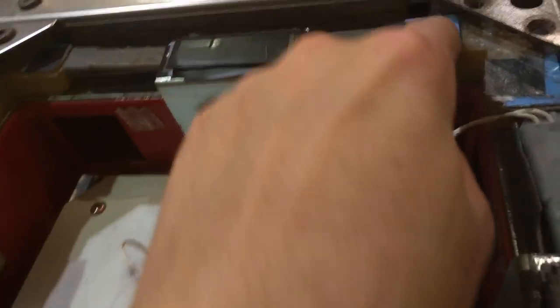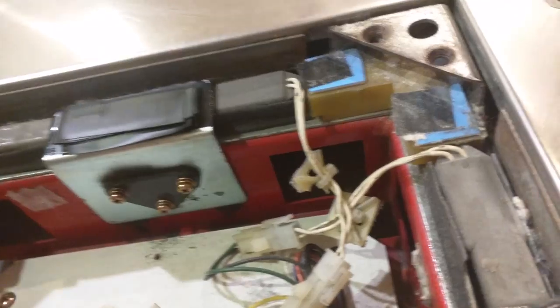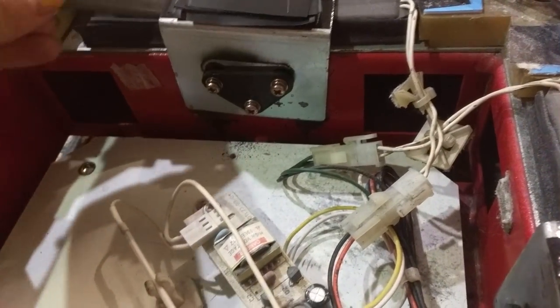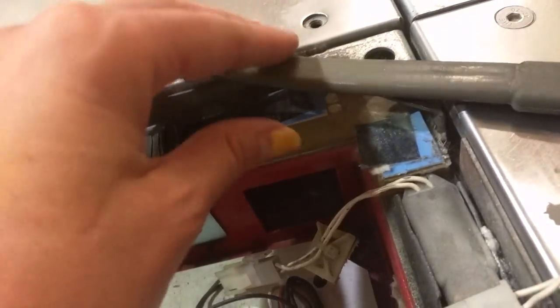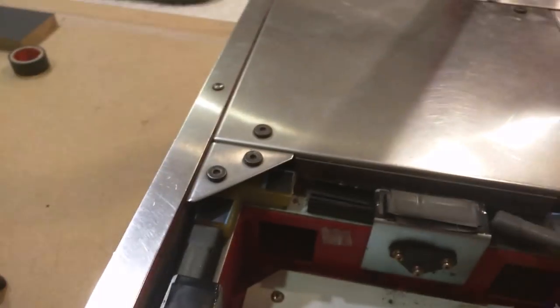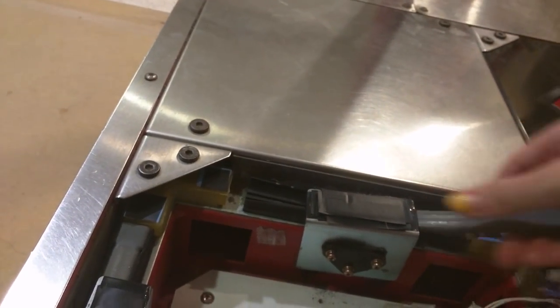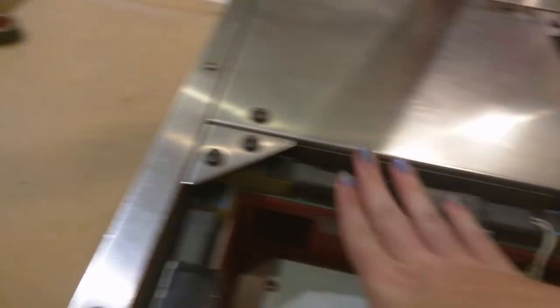I put some little squishy pads here — not necessarily foam. Foam is really thick and squishy. This is some sort of molding tape, something like that. These sensors I have put in the right way. Contrary to popular belief, this is the right way to put the sensor in along the track. I had two original sensors that had never been moved and they were facing this way, so I'm assuming that is actually the way you're supposed to put them in. So I put them all back in this way and I haven't had any problems with my right arrow.